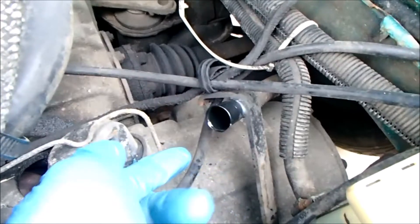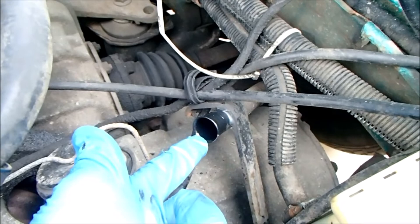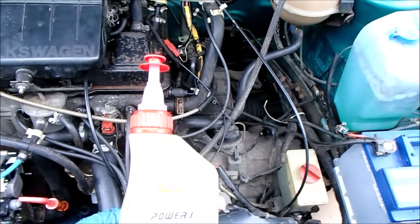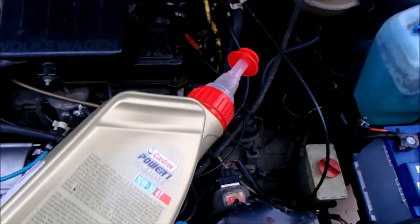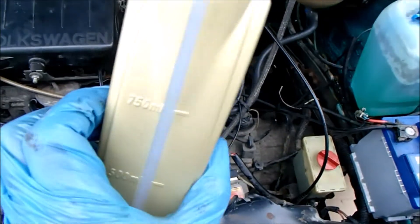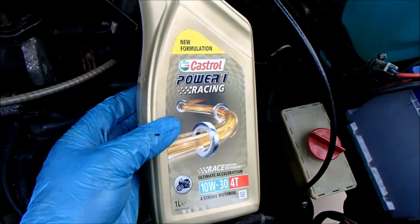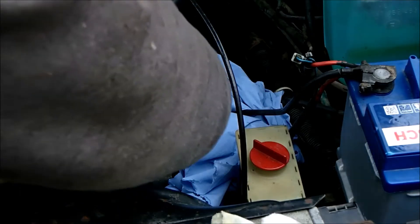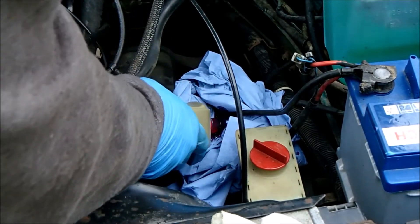The amount of extracted liquid poured into this jug is just under two litres. Filling up the gearbox is done through the dipstick hole, which is pretty tiny, so I've cleaned out this old oil bottle which has a narrow spout — it's had a thorough cleaning with brake cleaner. I can add 750ml at a time into the gearbox. We're aiming for two litres, then we'll run it up and check it and see what it's like.